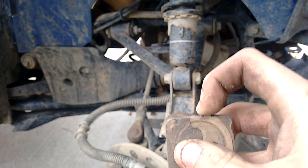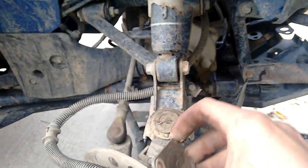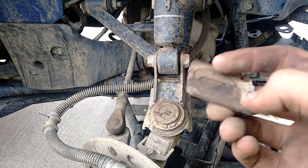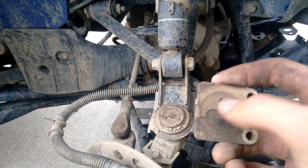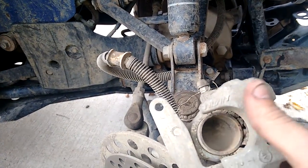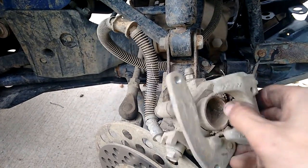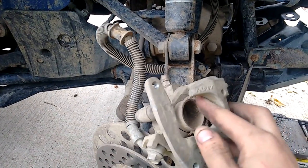The one Wolverine I had, the black and red one, the 2001, yeah, the 2001, I had to replace the back brakes because what ended up happening was the piston, see how it has this circle here? Well, that circle was a complete cutout. The piston itself dug right through the brake pad. I kept the brake pad because I figured it would be a cool thing to show other people and stuff like that. Got to take a video of that one, but pretty much same concept.